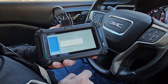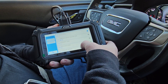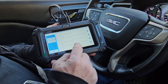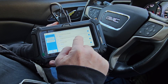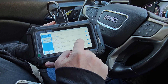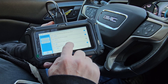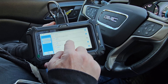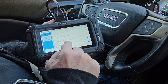So live data — you get a multitude of live data points. You can see the temperatures and percentages go up and down. It tells you everything: fuel pressure, rail reading, engine RPM. It just does a fantastic job at reading everything. Then you've got the absolute throttle position — right now it's at 16%, and it reacts when you're actually moving the vehicle or step on the accelerator.